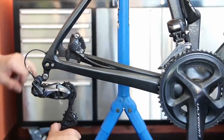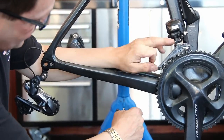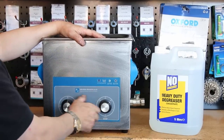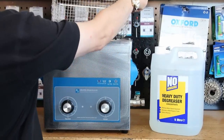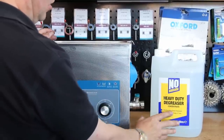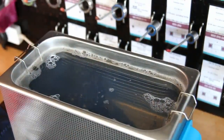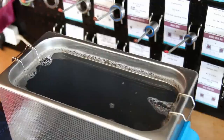With a service like this I can sort of clean up the main components of the bike without actually stripping it down, so this isn't a full detail service - it's not priced accordingly, it's just a regular routine service. We're going to strip down the bike and put everything into our ultrasonic cleaner. We use a nice degreaser that we pour into this, and all the components that we feel need cleaning go into this bath. They're agitated at ultrasonic wave level, and that really draws out the dirt and releases all the oils and greases. You can see we've got fresh degreaser in here and you can see how that cloud of oil is lifted off those components with the ultrasonic waves.